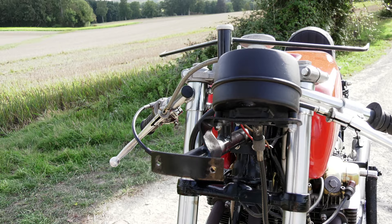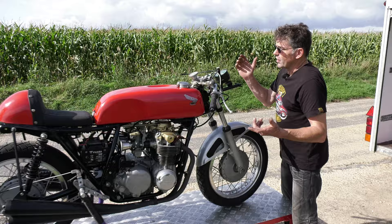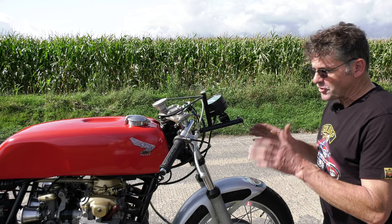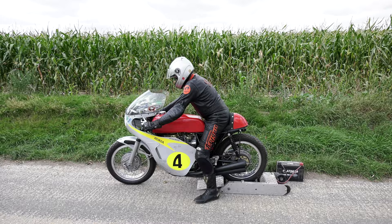You can mount on here, as I have. You've got your tacho here, your instrument. You're going to have your electronic ignition switch and indicator light. And you could just make a piece of aluminium like I've done here. That is all the original part of the bike — you can see where I've cut it all down. You're just mimicking as much as you can of something, and trying to use all your bits that you've taken off, rather than spend lots of money.